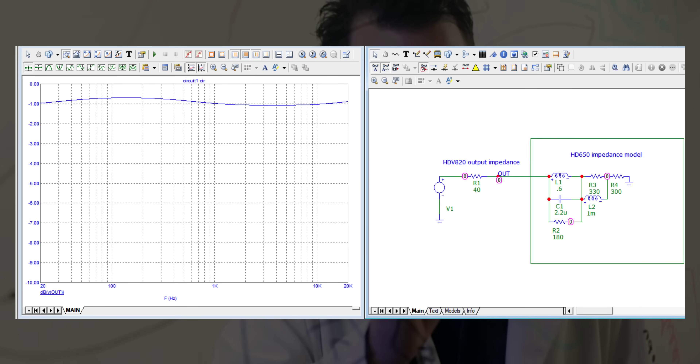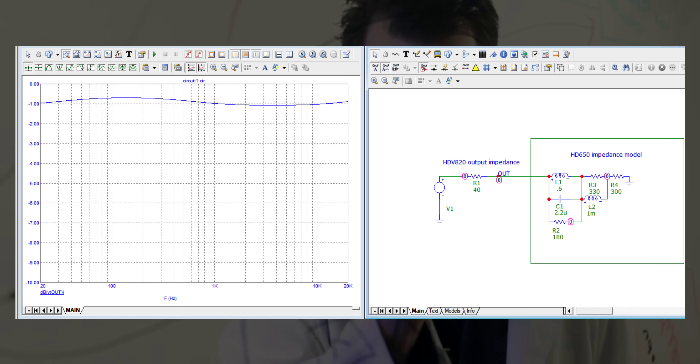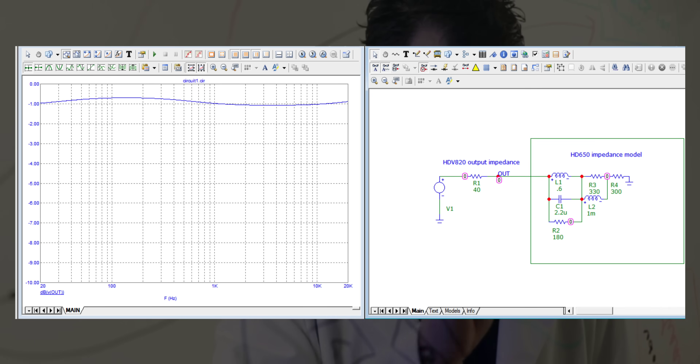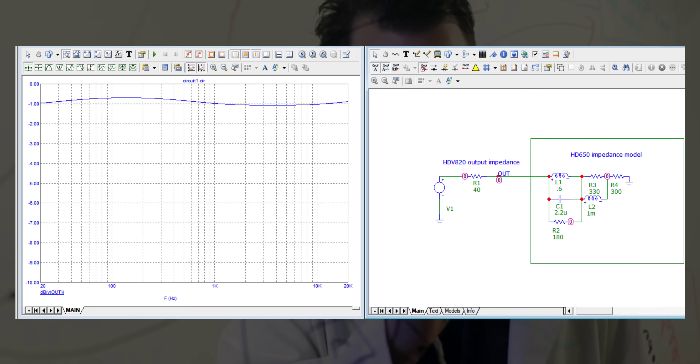When the impedance of the headphone and the output impedance are closer, this effect gets bigger. That relationship is usually referred to as damping factor, which comes from the fact that there are large impedance rises on the resonant frequencies of drivers, so a lower output impedance damps them by limiting the amount of boost you can get at that frequency. Some people misinterpret this to mean that low damping factor means the bass is uncontrolled, but it's really just a different way of framing a boost at the resonant frequency, just the same as any EQ. It's not like your amplifier is now producing a sloppy, uncontrolled sound — it's just changing the frequency response. Realistically, you're just changing the frequency response of the headphone based on its impedance curve.